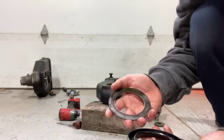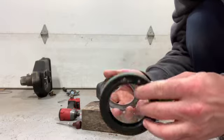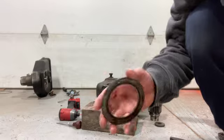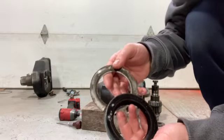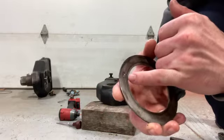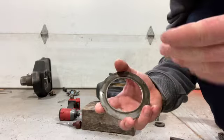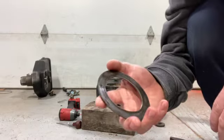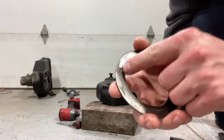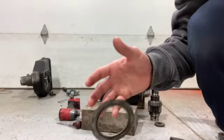All right, the only thing I destroyed during that removal process, other than the seal, was this washer that is right behind it. It's actually butted up against here. You can see the holes. I had to, because I could not get that out, and the screw wouldn't grab on it until it went through all the way. And I couldn't head it out with the hammer. It was just bouncing off of it, so it wouldn't actually push out. But anyway, just a washer. It does have to be flat. But I'm just gonna weld this hole up and bash it flat. So let's go do that.